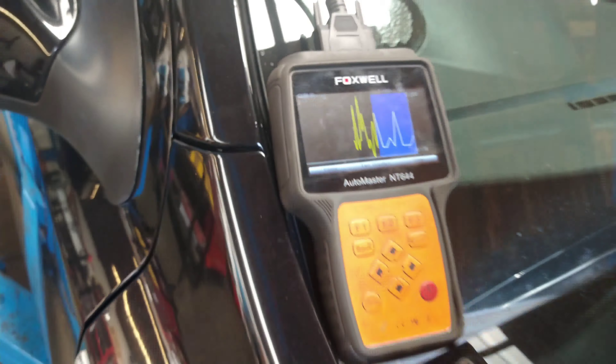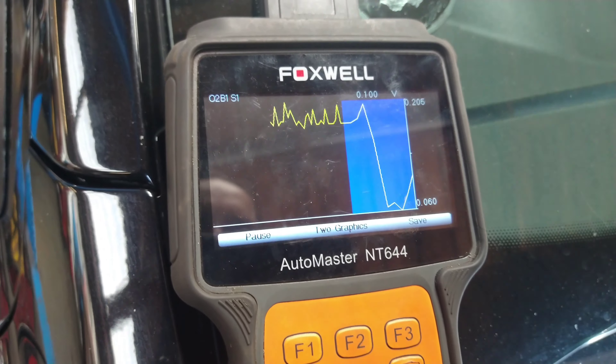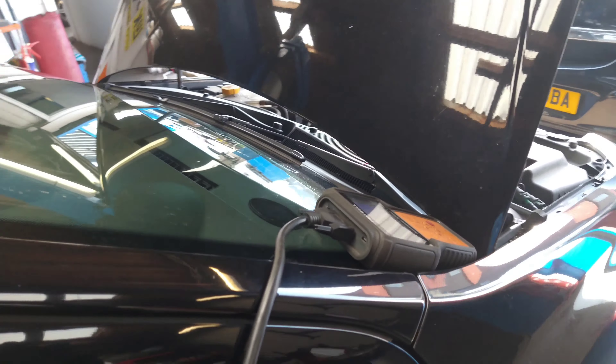That's still low. A little bit more. That was enough to get it to stall out and it's just gone leaner. So a quick test — it needs an oxygen sensor. It's not recognizing when it gets fuel, so it's making it run rich.